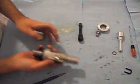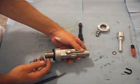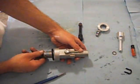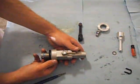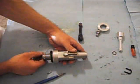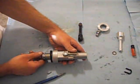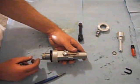Okay. You're going to want to install, if this is going into the car, into the firewall, through into the clutch pedal assembly, this would be the passenger side set pin and this would be the driver side set pin. You're going to want to install the driver side set pin due to the fact that once this is inside the car, it's next to impossible to get that pin in place, just due to tight, limited space, visibility, and just the way that this is oriented up into the car makes it very difficult to get this pin in.